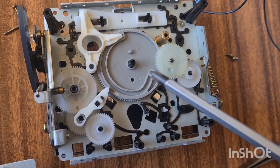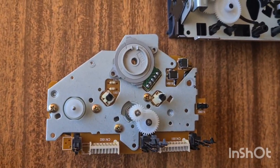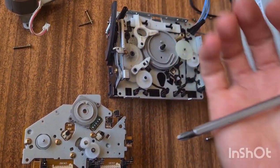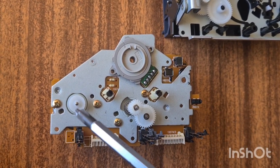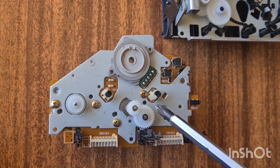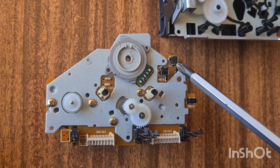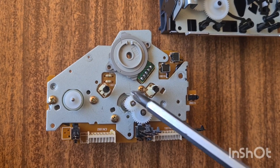This is obviously driven through your mode select wheel. Now I'm getting ready to rebuild this, but I'll show you what the actual problem was. This flips over and sits on top of the mode select wheel. This is the electronic controls for the two motors — one is your mode select motor, and one is your backup motor. You've got three switches here. These switches basically control the status of the tape deck, such as whether the door is open or closed. These can be tested by the contacts on the back with a multimeter very easily.